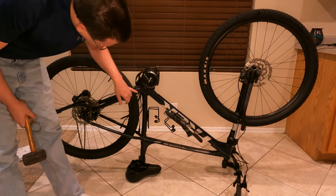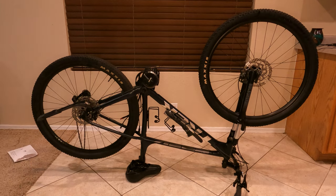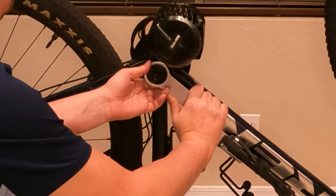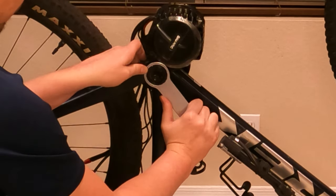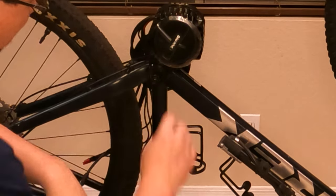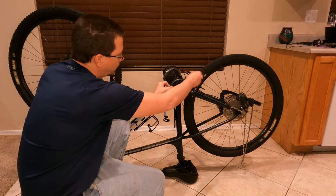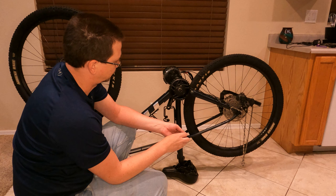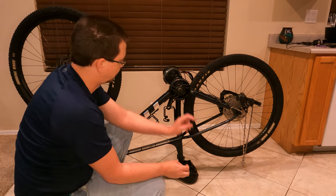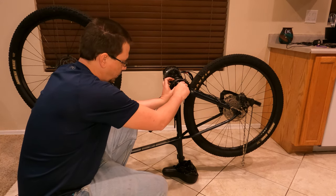I can add the outer ring on there — it's made out of aluminum, so I'm not using the mallet on it. It's just here to keep the other piece in place. Before I put the pedal on, I'm going to bolt the chain ring on using the five provided nuts. I'll be getting the 42-tooth later to correct the chain line, but I can already tell it's going to be an issue for the higher gears. I'll have both a 36 and 42 to work with.